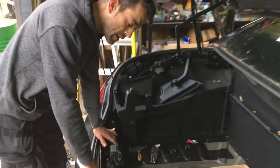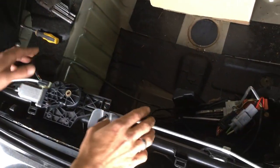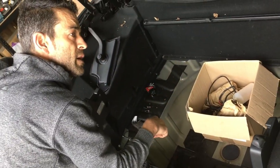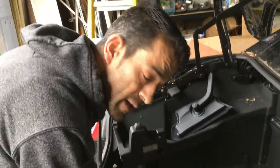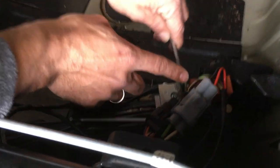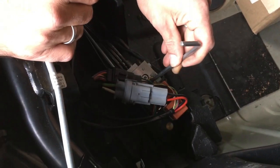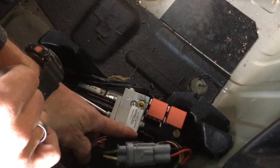I'm at the point where I want to actually replace the hydraulic motor. Basically you remove everything from your boot. This is the motor that controls your two arm flaps - that is connected to the pump and the motor. We're not getting any noise from this pump, it's like it's getting no power. I do have a spare pump though - this was purchased for my previous Peugeot thinking that one was faulty, but it wasn't, and I know this was a working pump. So Tommy, I think we're going to disconnect this pump quickly and get that replaced. What we're going to do first is just relieve the pressure from the hydraulic system - that's this brass screw here at the top.